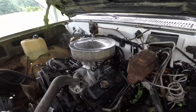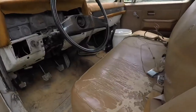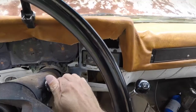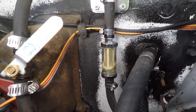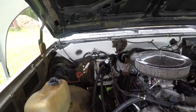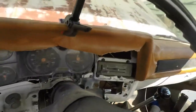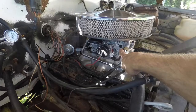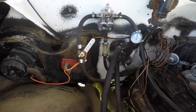I did spray water all over the engine, so I'm a little concerned — did we get any water inside? I've got the battery in now. I think this thing may be out of gas. I was messing around with it a couple days ago and it ran out of gas, and I barely had any in my lawnmower gas can. I can hear the fuel pump running, but the fuel filter isn't even filling up — there's not enough fuel in the tank. So I had to run to the gas station. Just bought some gas — put about two gallons in the truck. Now I can hear the fuel pump sucking the fuel, and you can see it coming up in the filter. The carb has fuel. This is actually a lot easier to see now — before I couldn't really see in there. I guess I didn't realize how dirty it was.